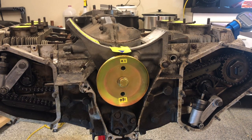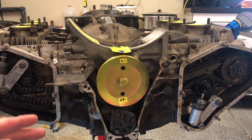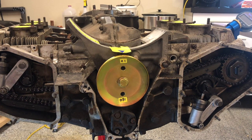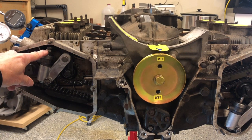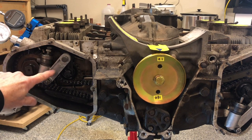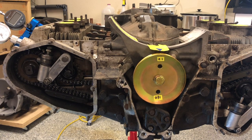So why are we talking about all this basic stuff? When you're doing engines, it's really best to never take anything for granted or assume anything. You want to have a complete understanding of what everything is, how it's laid out, and how it's talked about throughout the process. Also, this engine was worked on right before it was parked over 40 years ago — it's got some fresh surface work in there. Before I take this engine apart, I want to know: did the guy working on it use the correct parts, did he do it correctly, did everything measure out correctly? We can see on this side we've already got issues with the tensioner — this has got a manual override on it, so this has failed in the past. So there's been problems inside this engine, and we're going to find out exactly what's going on once we get it apart.